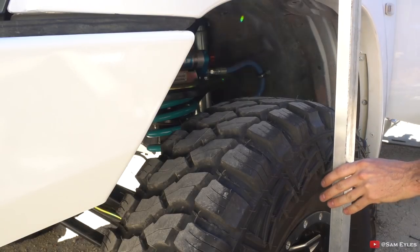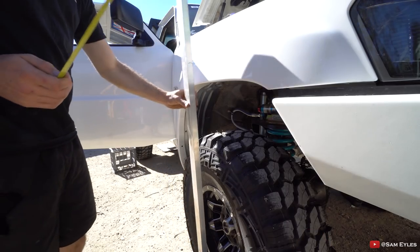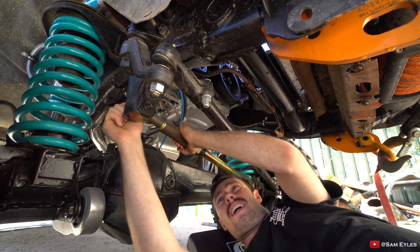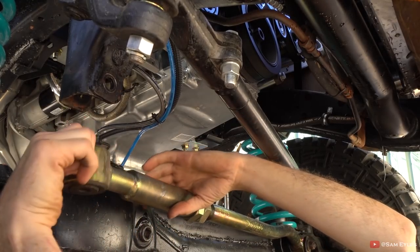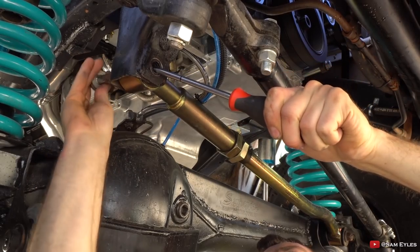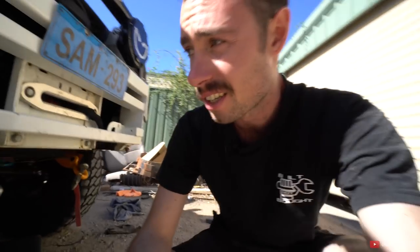Actually I'm going to hold this bar up against the tire and measure to that. On one side it's 42 and a half, and over here it's 41 and a half — so it's got to come this way, about five mil. I need to pull this pin out of the panhard and wind it out to get that five mil extra. A lot of times when you do this adjustment you have to give the car a bit of persuasion to come into the right position, so I might get a screwdriver and just try and push the car across to line up that bolt. There we go — 36 and 36. That's bang on, good enough for me. We'll get the boys to check it, tighten this thing up, and do the back.